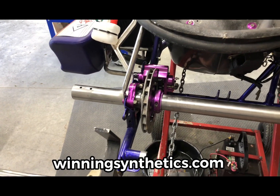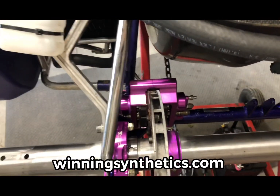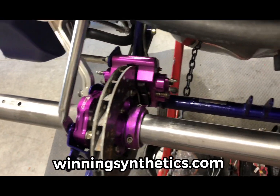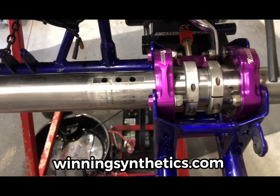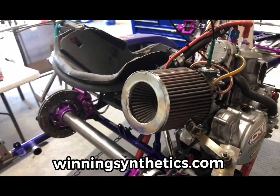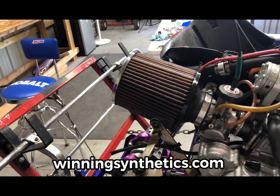All right, as you can see, the rear axle with three, count them, three new bearings has been installed. Our brake pads, rotors, and calipers are all in place and clean. The cassettes have been cleaned. The housing, or the holders here for the cassettes, are clean, and we're actually getting the motor put back together. This is our freshly cleaned and re-oiled air filter, reinstalled.